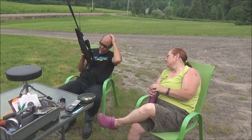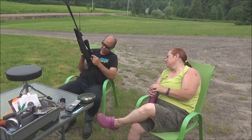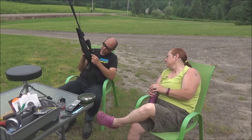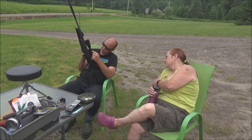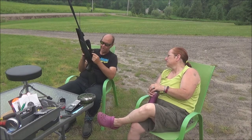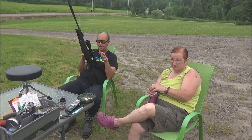And what I would advise to keep pressure proper and even is start at the back or the front, doesn't matter. I always go to the back. I'm left-handed, okay? So I go to the back, very back screw, front screw, this screw near the back, and then this screw near the front. And I keep doing that until it's snug.